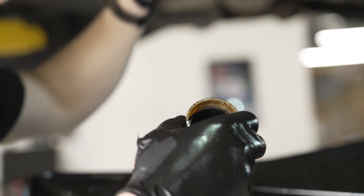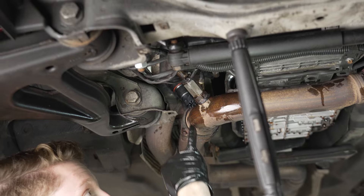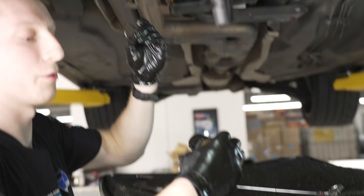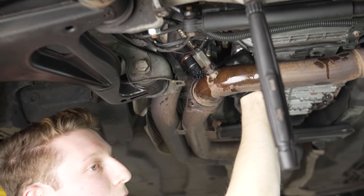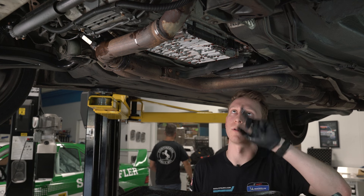As you can see, the pilot bushing right here is filthy and more importantly it's actually full of fluid. So this car may have been susceptible to that issue I was talking about earlier with the pilot bushing and fluid wicking up the harness. Looking at the actual plug itself there's almost no fluid — just a little bit of residue — so you're going to want to make sure you get both of the o-rings out of that hole.